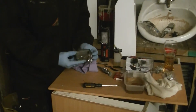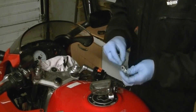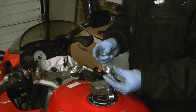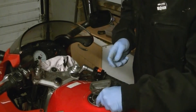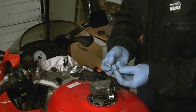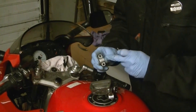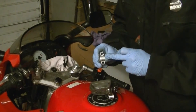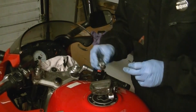It's time to put the master cylinder back onto the bike. We have our master cylinder and our handlebar clamp. First of all, I'm going to put a bit of copper grease onto the bolt. You'll notice with the clamp for the master cylinder it actually tells you which way up it's going to go, as indicated by an arrow and the word 'up' — a bit self-explanatory.